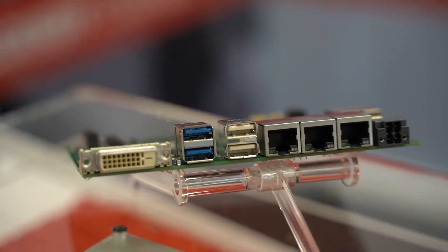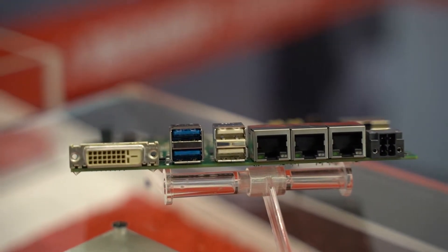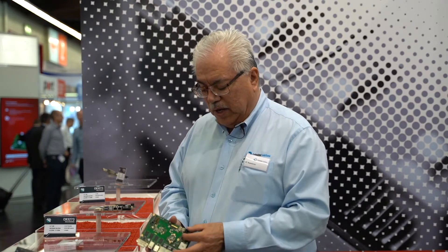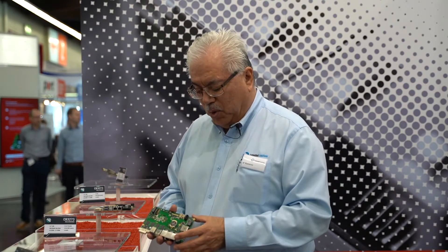The HDC shares a lot of the same I/O functionality, but it does have a third LAN port and the same soldered down memory. It has less onboard expansion but does offer M.2 2242 SATA storage and M.2 2280 PCI Express storage, as well as one SATA port and the possibility of doing UPS type functionality.